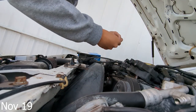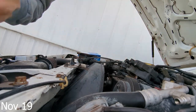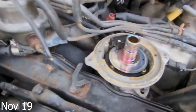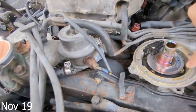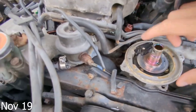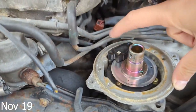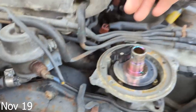The plate is off. So I got that plate off and now that's the crank angle sensor — this little thing right here. Under this disc I have to keep it, and I think I have to place it down a certain way, so I've got to be real careful about this disc. But yeah, this little sensor right there is what I'm changing, and then the rest of the new distributor parts can go on.